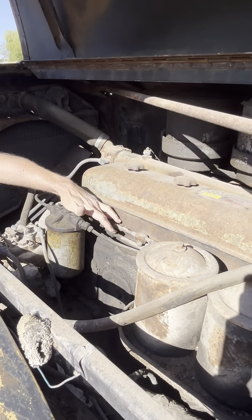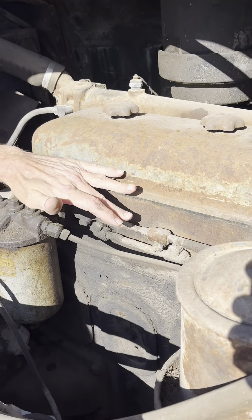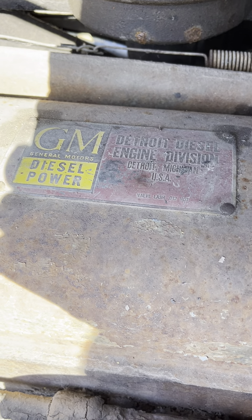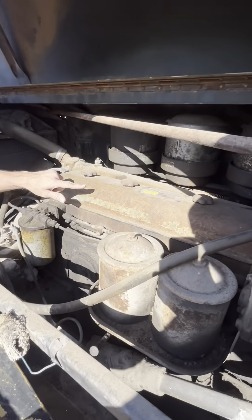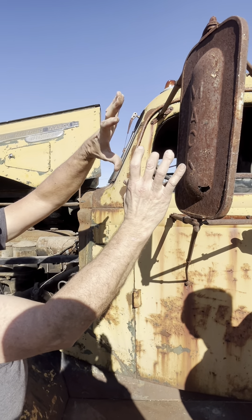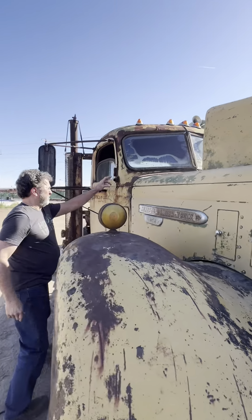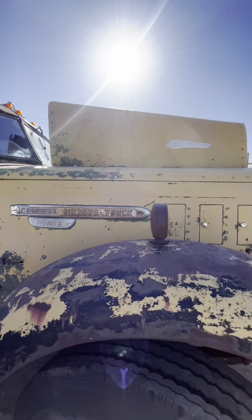Here you've got these external fuel manifolds — that's probably the original head. A lot of engines have had later heads put on to have these fuel manifolds with the supply and return drilled inside the head. So that's old and probably original. This valve cover is original — the GM Diesel Power plate at the top. That's before they started stamping these covers with 'General Motors Diesel' embossed, which predated 'Detroit Diesel' embossed in the same lettering. So this is the oldest valve cover. The mirror bases are here — you've got both of them. All you need to get is an extension arm and a mirror head. Half the battle — that's most of it right there.